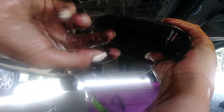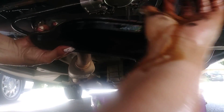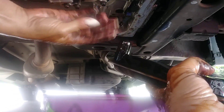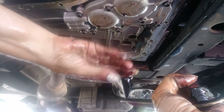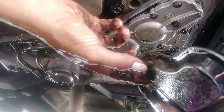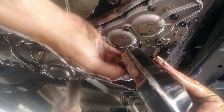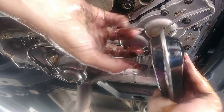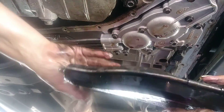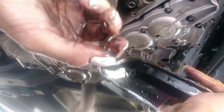Make sure this part matches — there's a big tube hole right here where this fits in, kind of like a little plastic thing. This one's actually metal, oddly enough, and there's a filter kit inside. On a lot of them you can see the filter — it'll be a real thin mesh thing. When that gets clogged up, the transmission will run hot because it's not pumping the fluid up out of the pan like it's supposed to, and it makes the transmission overheat.